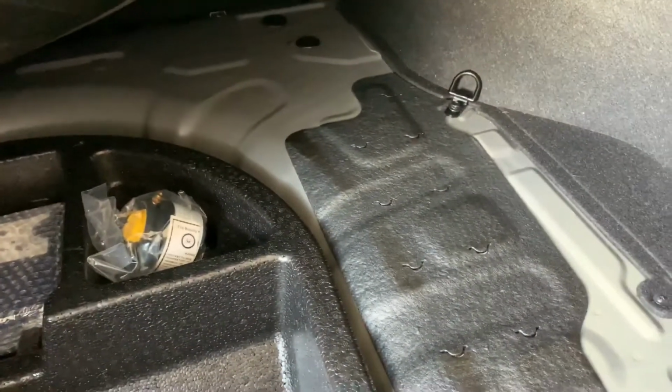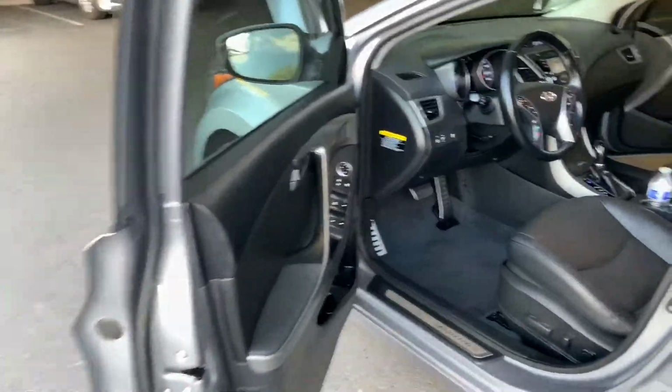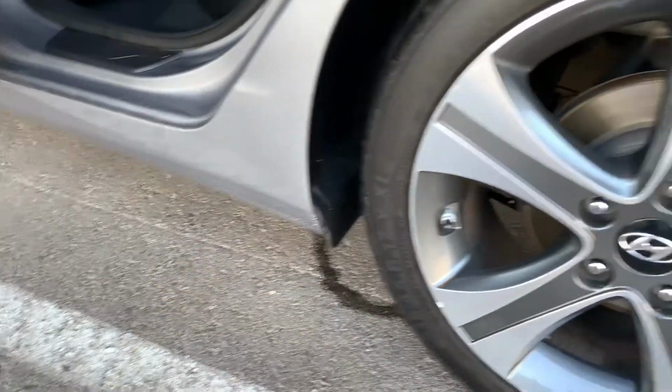That which is attached to your both left and right rear rail, that you also want to check for. There's also spot welds on there that are from factory. But yeah, right under here, which you can't really see in the video, is your left center rail. Sometimes they can have a kink, that can affect the structure of the car.